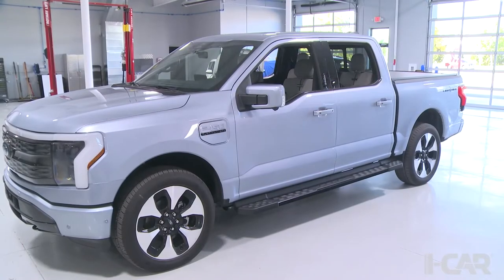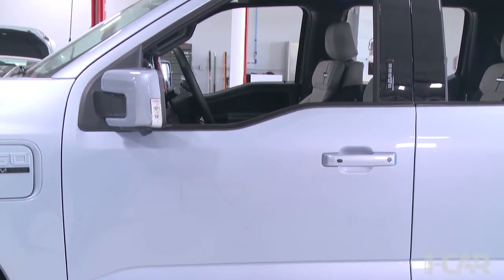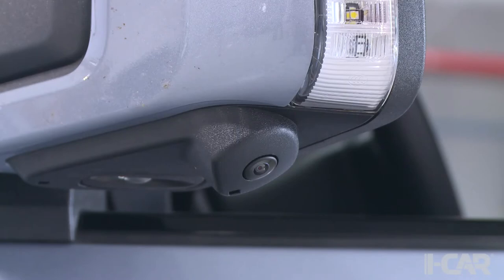Absolutely. As we continue on to 08, I'm just looking at the side of the vehicle, and I did quite a bit of research, looking to see where potentially there were differences. And just looking at the doors, it's pretty much business as usual for any F-150 whenever it comes to the doors and the features of the doors. Obviously, depending on your trim level and the options on the vehicle, this one has the 360 surround view. And Joel, what can you tell us about a calibration on a 360 surround view on these late model Fords? So on this model here, it's going to be a dynamic calibration. You're basically going to set up FDRS and go into the calibration, click calibrate, drive it around until it says you're done, and that's about it. Pretty straightforward so far as that goes.